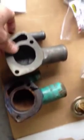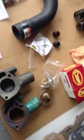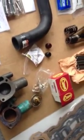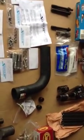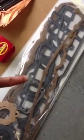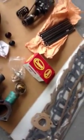Finally, I bought a new thermostat housing because, as you can see, after years this one has corroded, so I bought a new one. I also bought a new thermostat. Always watch out when you buy a new thermostat that it is of the same degree — the temperature at which the thermostat is supposed to be opening.